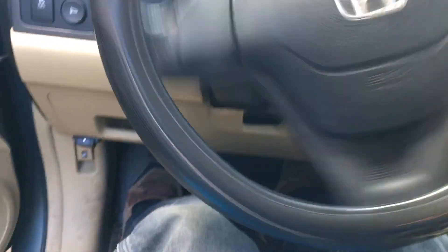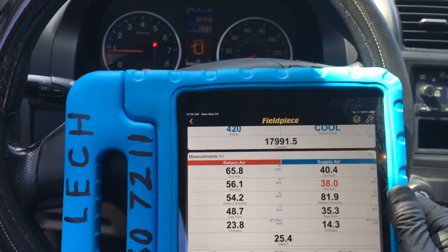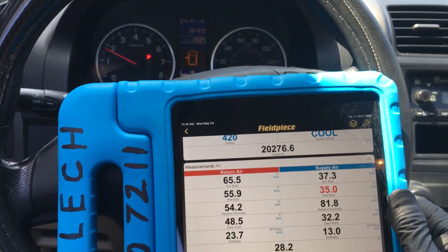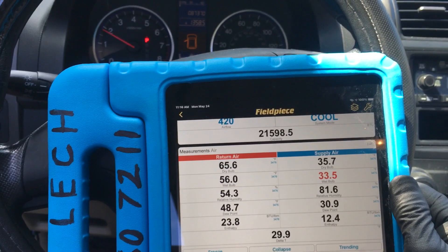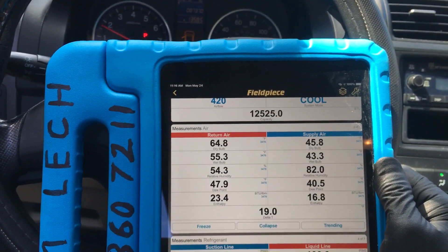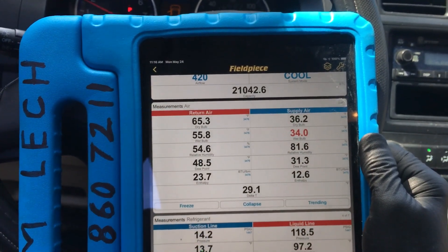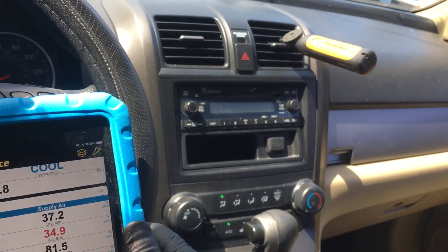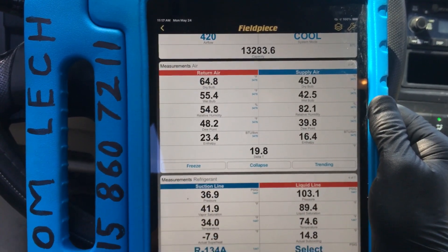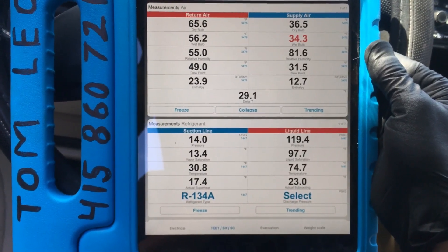Let's bring up the RPMs a little bit and see what happens. You can see the RPMs in the background — let's go up to about 1,600 to 1,800 RPMs, like you'd see cruising down the street. The compressor is a manual clutch compressor, not a breakaway clutch — it has a clutch on it and it's cycling. We're hitting 36 degrees Fahrenheit coming out of the dash temperature gauge. When the clutch clicks off, the pressures and temperatures drop, the low side goes high — and look at how low that section reads.